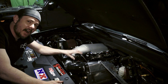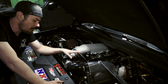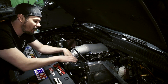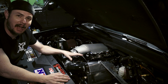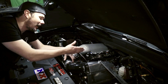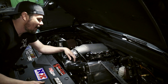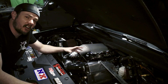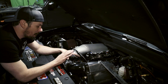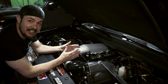What can we do about it? We're already tuning the speed density table, and by doing so we can come back in and enable the mass airflow sensor at a higher RPM. We'd have to tune with dynamic airflow on and then set a filter up based on our switchover point — basically when we're in high speed mode, where mass air is doing the majority of the calculations. Even in high speed mode we're still referencing the VE table, but all of the fueling is pulled from the mass airflow sensor unless there is a correlation error — and that's what actually killed the motor, as you guys well know. The approach of the mass airflow sensor being the easy thing to tune is just not working in this situation.